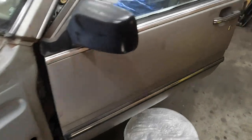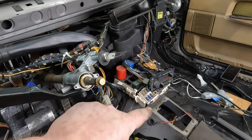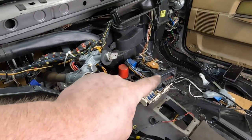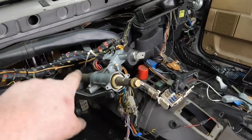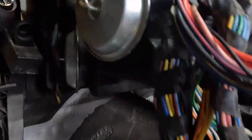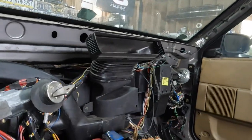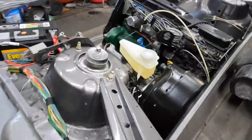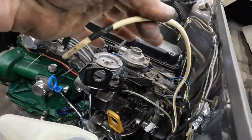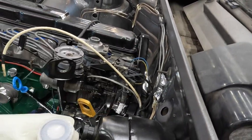Moving along to the inside of the rig. Went and put the fuse box mount back in from last time — just some screws and it clips down in there. All of the vacuum lines coming from the HVAC control panel are all plugged back in. You want to write what color each hose is when you take them off so you get them back in the right spot. That harness down near the injection pump also gives you the feed line for the vacuum pump, which moves all those vacuum motors around. There's a gray one — I don't know what that does yet, but we'll figure it out.